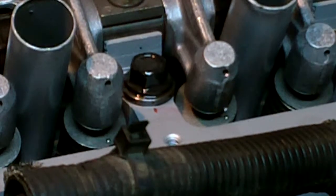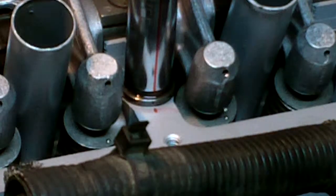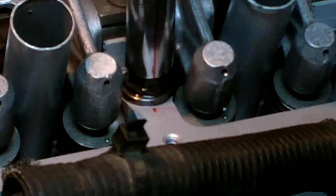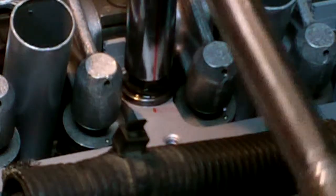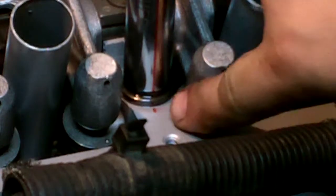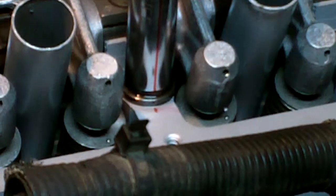Now the red mark — I'm being careful not to smudge my lines. When I pull a little tension, my red line lines up with my mark. As I'm turning, when the next red line appears, I've turned it 90 degrees. So I just put my socket on, make a mark, give it a pull until I hit 90 degrees — that's a quarter turn — and that's how I'll set my bolts and know I have it correct.